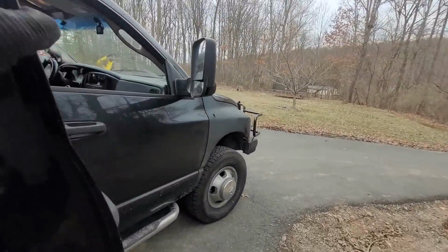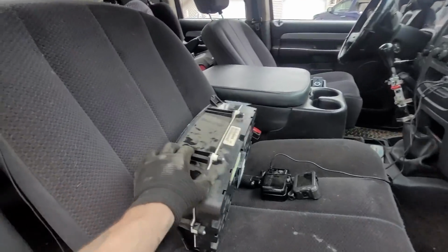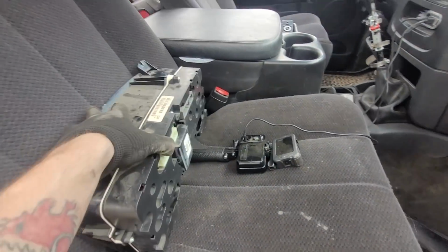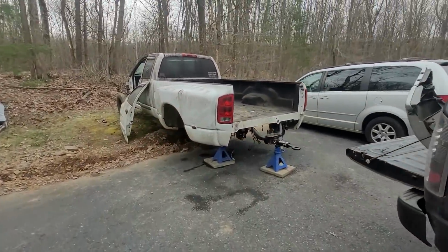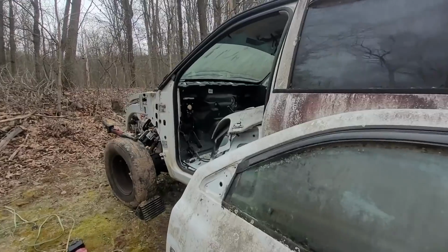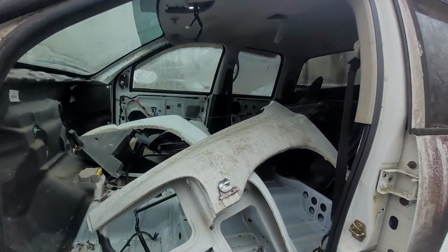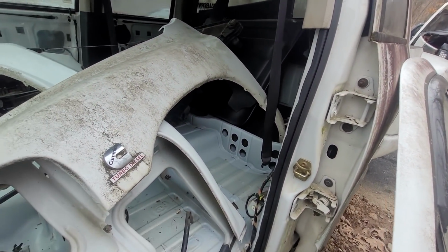I haven't been pressing on selling anything. I didn't post anything up. So instrument cluster, 250,000 miles. Anybody needs it, will not fit an 03. I had two guys try to buy it and they had 03s and they will not work. For some reason, the connectors are flip-flopped. And even though they'll plug in, they will blow a lot of fuses. Ask me how I know, because I did it. But if you guys see anything in here of value, I'm gonna pull these out.